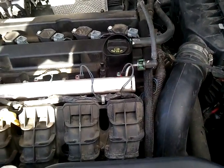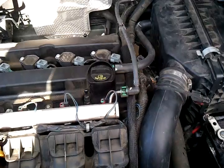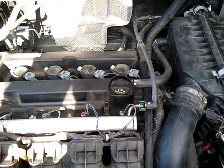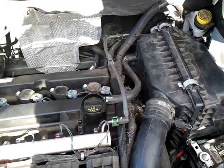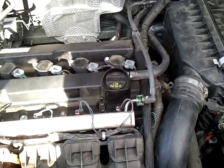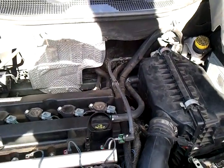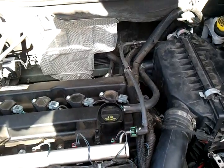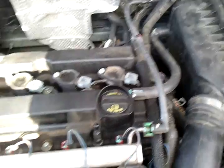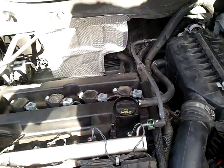There was a PDF on the RockAuto site that said once you replace it you have to go through a relearn procedure. First clear the codes using a scan tool, then accelerate to 70 miles an hour and coast down to 40, then accelerate back to 70 and coast down to 40 again. It has to be closed-throttle deceleration - your foot completely off the gas when you coast down. You'll need to find somewhere you can do that without alerting the cops. I went through that procedure and the problem appears to have completely gone away.